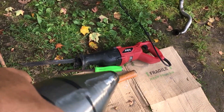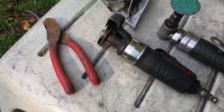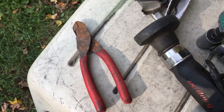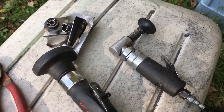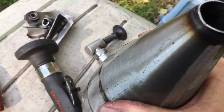The three tools I used to cut this thing up were simple. I took all the big stuff off with the Sawzall — I did not use the hammer or the pry bar, those were from another project. I basically used the Sawzall to lob that off, then used the cutting disc going right on the welds back and forth until I could break them off. Then I used this grinding disc to clean up all the surfaces and make sure they're all flattened and smooth.